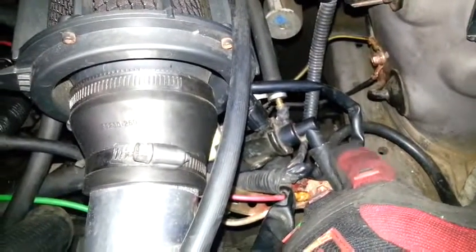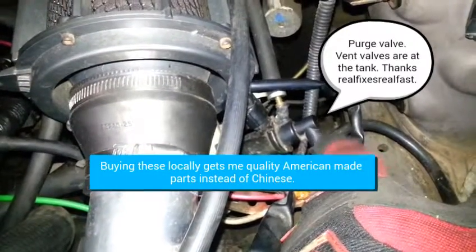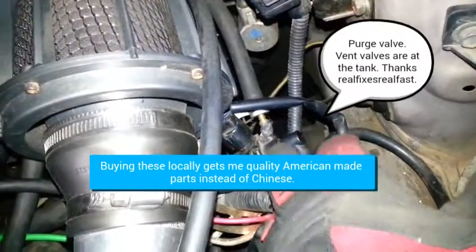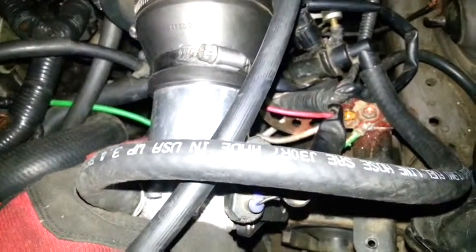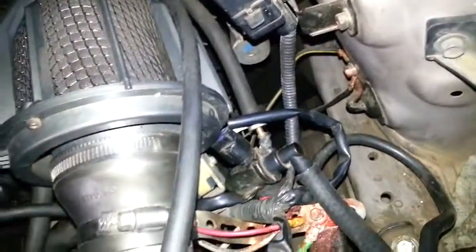This I actually stole from my vent valve — or is it purge valve? I always get those two mixed up. So this guy right here is the last guy before your EVAP system gets back into your intake and gets re-burned. But I don't think that connection is too good, because I was getting desperate trying to make fewer parts do more.